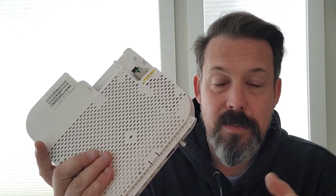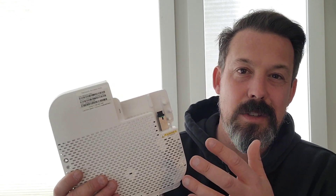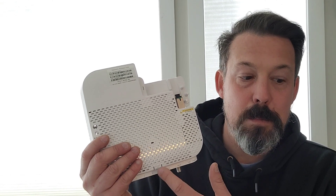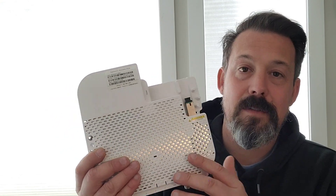You have to be very careful with that, because you're basically bypassing the firewall that's in this router and everything plugged in will be directly on the internet itself. If you've got a VoIP phone plugged in there, you will get hacked almost immediately. If you have a phone ringing every time you hang up and pick back up, or it says SIP Vicious is calling, that's a hacker thing — you're not behind a firewall, you're just right on the internet. The only thing you would really want to plug in there would be another router, not a switch. Plugging a Wi-Fi booster in so all your devices pull public IP addresses will mess everything up as well.